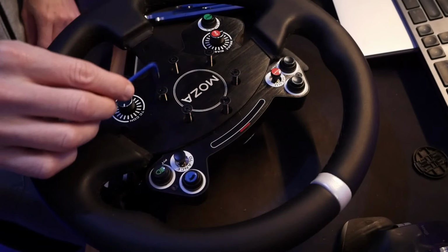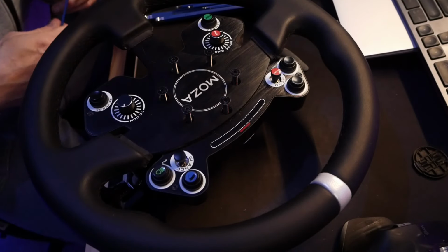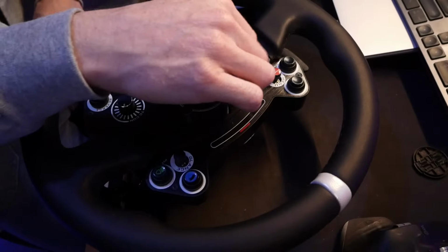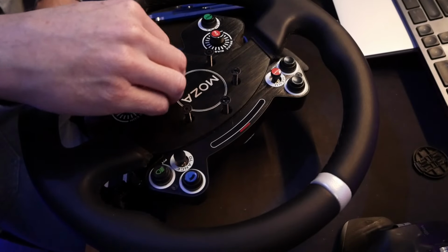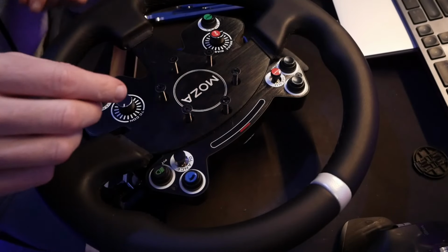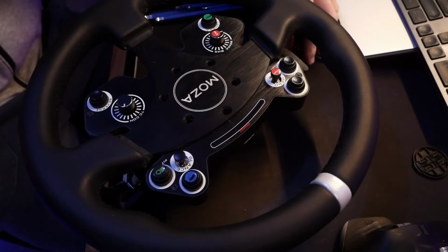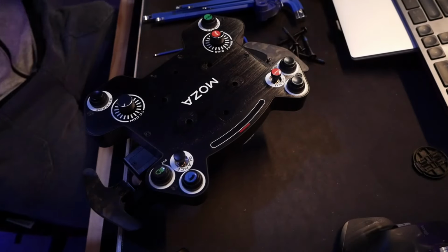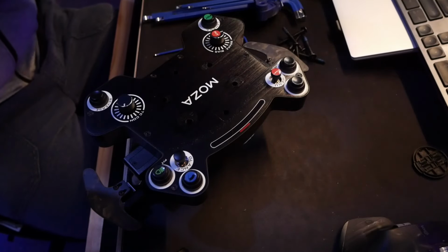If you've ever done a wheel up on a car properly, you should always undo the wheel diagonally, and do the wheel up diagonally as well. Okay, nearly there. And we're going to reuse these bolts in the next wheel. So I might even weigh them both while I have them off.